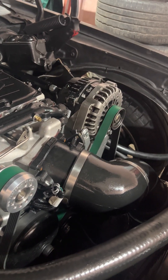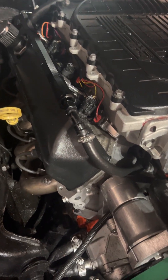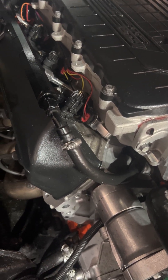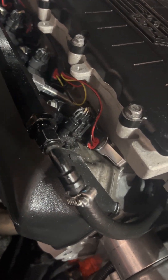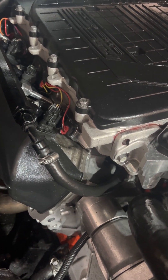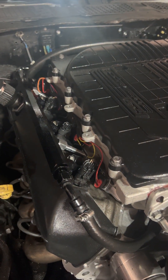The plates from Too High PSI bolt directly to your heads. They also sell injectors. There are three different kinds of plates — the ones I got are the SC plates, which means you can use them with the stock location for your coils. All the other plate options require a coil relocation kit.